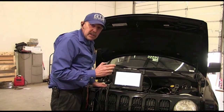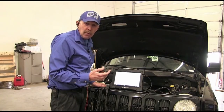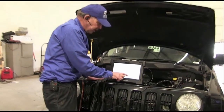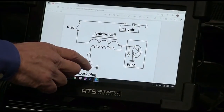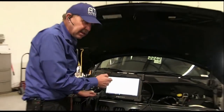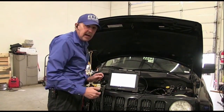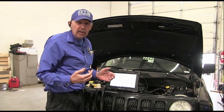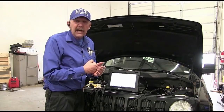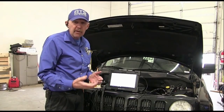So I'm pretty sure what's getting the current into the crank sensor is through its ground. If I can get high energy into the ground leg and the grounds, it starts to drift up into other grounds, like in this case, the crank sensor ground. Now I have a real negative potential current that goes into that gate and it shuts it off, and then the crank sensor stops pulling to ground.